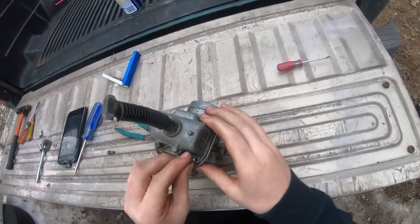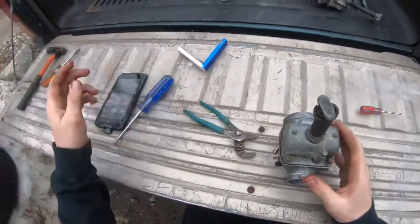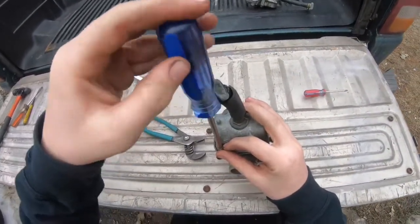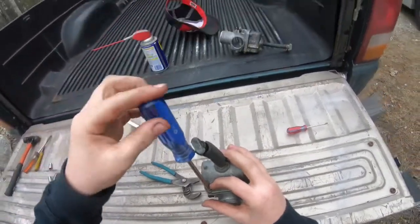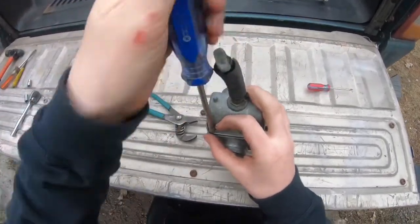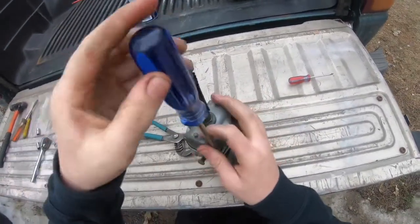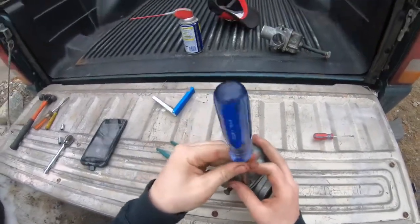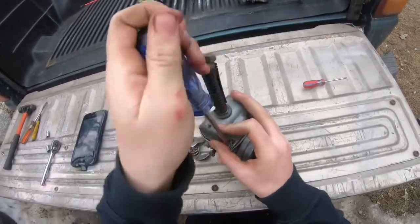That's pretty much just the ups and downs of it. Not really any downs, because it's really easy. And if you have any dried gas on the inside, you should scrape it out, because it can flake off and then get stuck in a jet. Or if your floats aren't moving up and down, that will make your machine act like you're not giving throttle, or like you are giving throttle. It's pretty complicated. Just make sure it's clean and it should be alright.